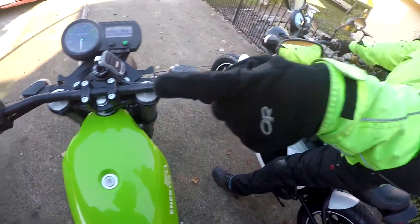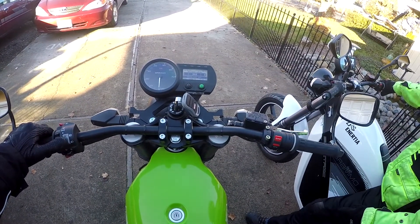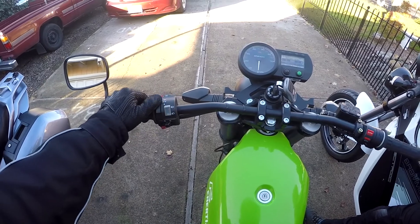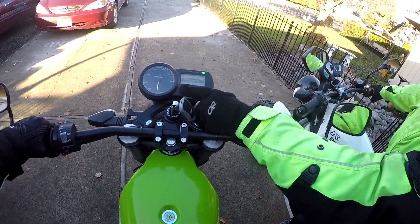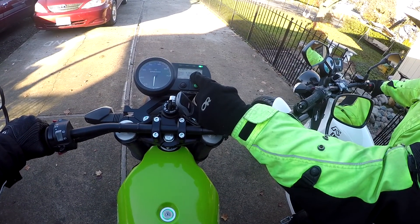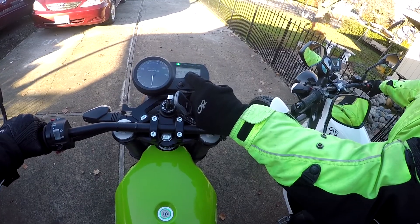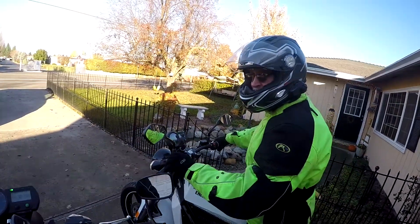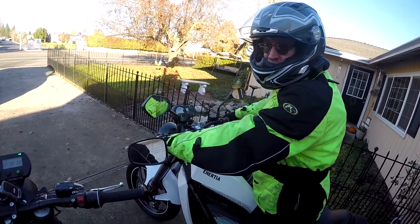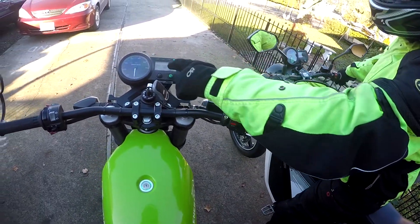Alright, so kill switch on and headlight on and you should get some flashing green lights up here. The headlight switch is this one. There you go. That way you got your power meter, that shows your power output. The motor temperature — if it gets up to 230 degrees it'll go into thermal cutback, so it limits the amount of power available. It helps conserve the motor so it doesn't get too hot. And there's your battery percentage and your range.